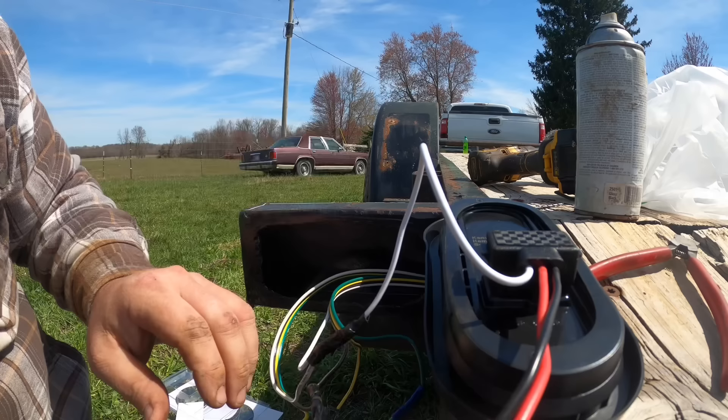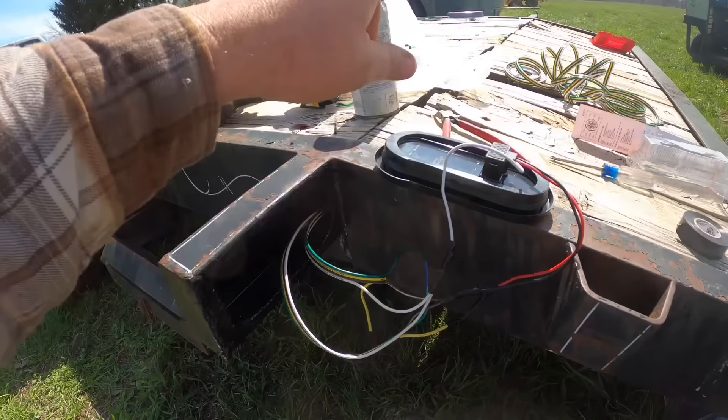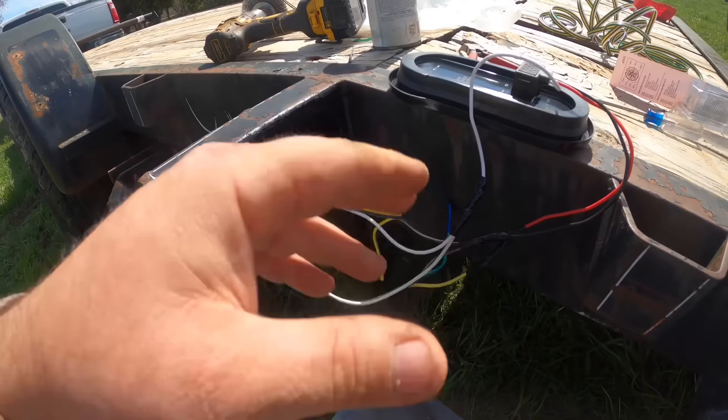When we want to do backup lights, my plan is I bought three junction boxes and we're going to have one under here somewhere on the inside of this frame rail. I could bolt it in above the ramps — that would be out of the way. Then I can run my wire short over here. For each light you basically use one wire for the color, one for the marker, and the ground, and I can use the extra wire for the backup light on that side.